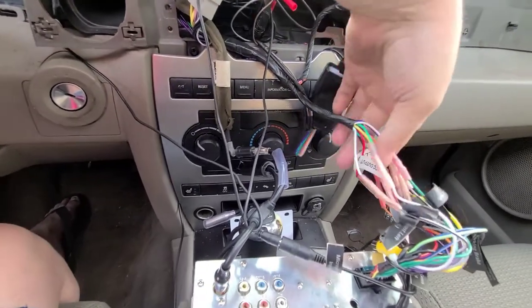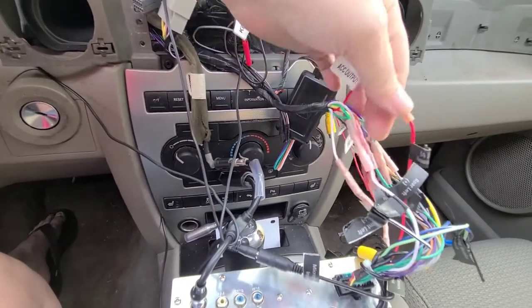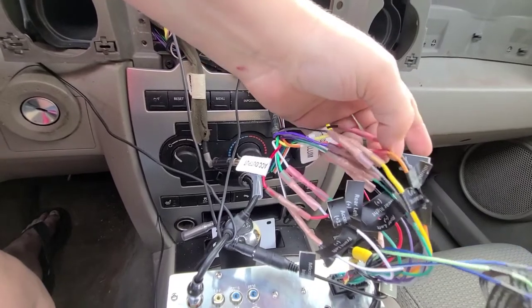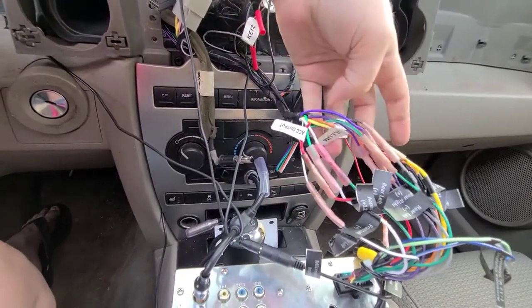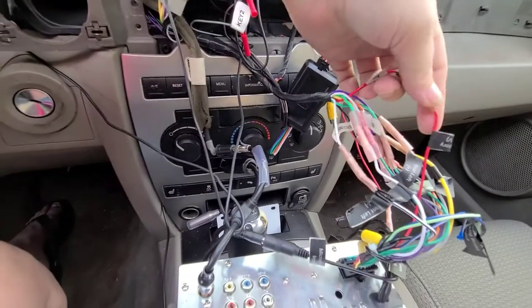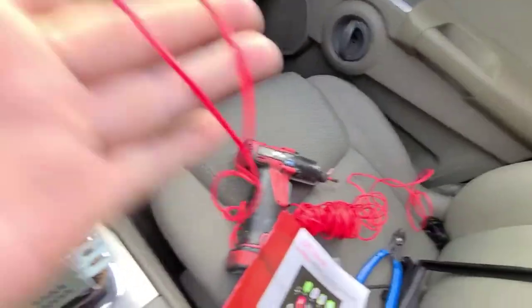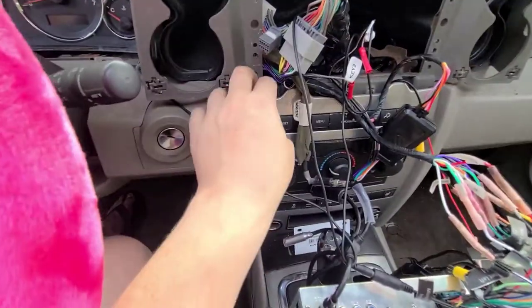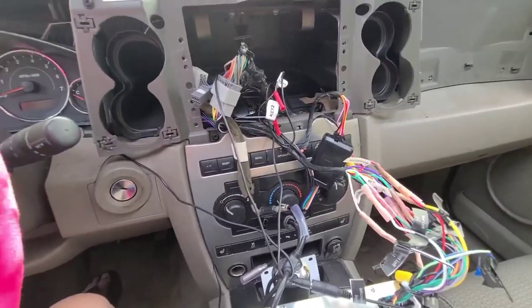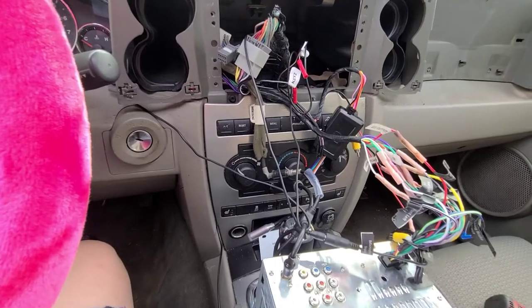The last issue is accessory. It's either this one. That's the ground, the illumination. The red wire. So this is the wire I need to cut. And then I have more wire down here, and we're going to run it behind this and connect it to the back of that port so that it'll shut off when the vehicle is shut off and not drain my brand new battery. So I'm going to cut this and then we'll continue from there.